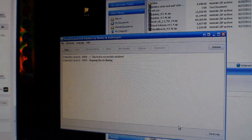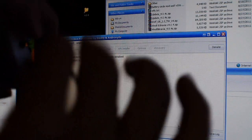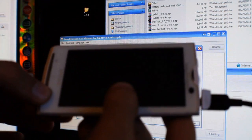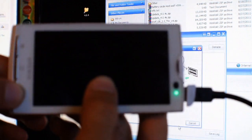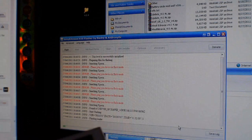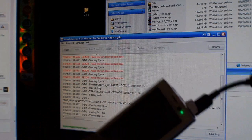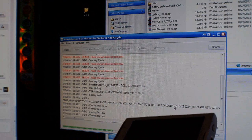On the phone, I'm going to connect the cable, make sure my battery is here, and hit the Back button. Then I insert the battery and the flash tool should pick it up — right there, it did. You can let go of the Back button now. It's flashing.